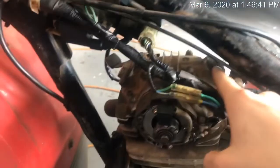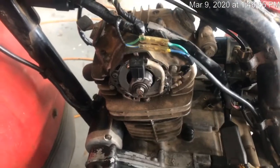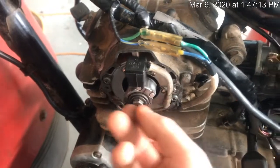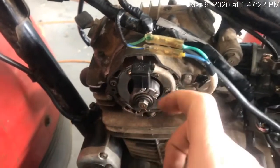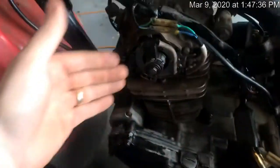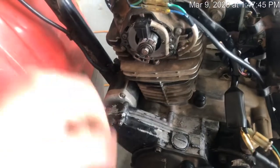So my brother and I were working on this together - he was checking the valve lash while I worked on ignition. He told me to set it to top dead center with the firing piston's valves closed. I pulled the inspection port and we noticed the magnetic pickup rotor right here was facing down instead of up - 180 degrees out. Somebody had taken this nut off and put it back 180 degrees out. I didn't think you could do that because it's connected to a mechanical advance, but you can pull the mechanical advance ears apart, take it out, and rotate it.